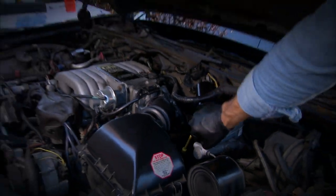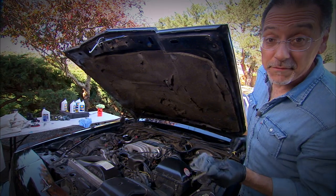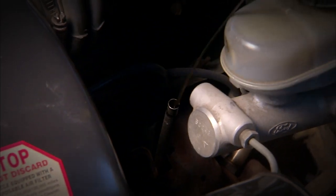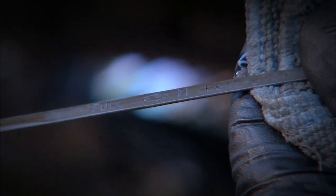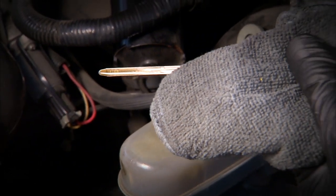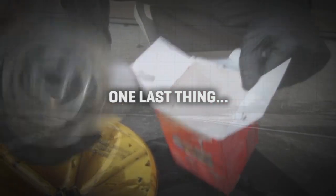Here's your last step and it's very important: get the car on level ground, turn the car off, and pull your dipstick. You want to make sure, regardless of how many quarts you put in, that it's actually the right amount for the engine — don't ever trust the number as much as you trust a dipstick. Take the dipstick out and clean it once. Don't trust the first pull because the car's been running, and that creates turbulence which gives you a false high. Then pull it out again and read where the hash marks show you where you should be — just about to full. Notice how nice and clean that oil is too.